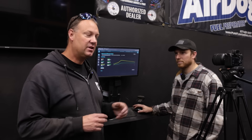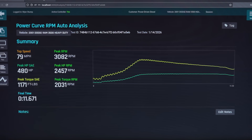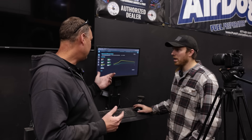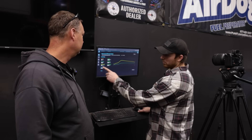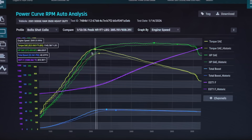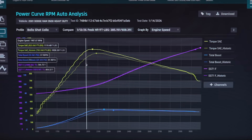We are done testing with the stock airbox on the MBRP 4-inch exhaust system. We made 480 horsepower — that's like one horsepower more than we did with the air intake alone. But it's actually a bigger story, a bigger difference than that. I want to show you some stuff on the screen here, because the exhaust, in my opinion, was a better power adder. Even just driving on the dyno I could tell. Before I click away — 1,171 torque. I think it was like 1,020 or 1,040 before, so a good bump there. The brighter line is the 4-inch exhaust; the duller line is stock airbox with factory exhaust. The torque curve is way higher.